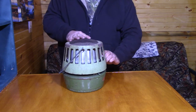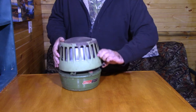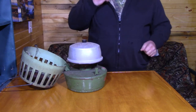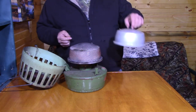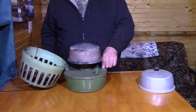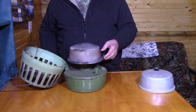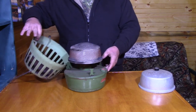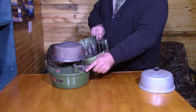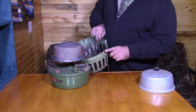The way these work is there's a switch here. You pull that in and lift this top off — the top's hinged so it just opens. This here is the cover over the catalytic portion of the heater. You get your fuel fill hole. On this side over here you get a little knob: push it forward and it's at start, pull it back and it goes from high to low. It's marked here on the side.